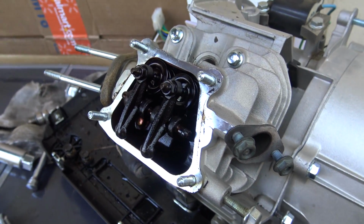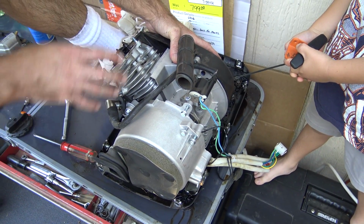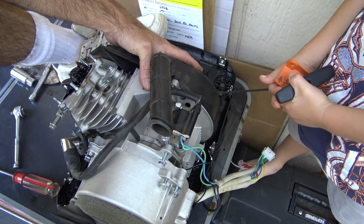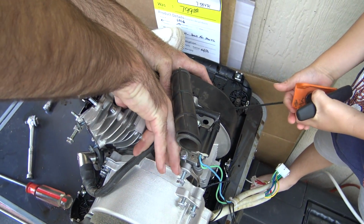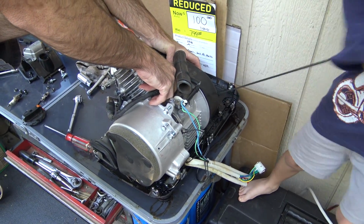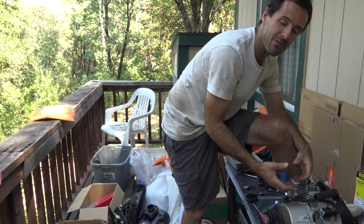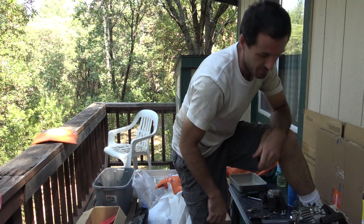Nothing in there screams catastrophe. I'll just have to dig a little deeper. Okay, I've got that head exposed, but before I remove it, I want to give you just a quick little demonstration of just what kind of compression we're dealing with. I'll put my thumb on the spark plug hole. Give that a pull, son. So my thumb probably has 5 psi of pressure, and the sealing power of the piston rings can't even overcome that. So hopefully I'm on the right track here.